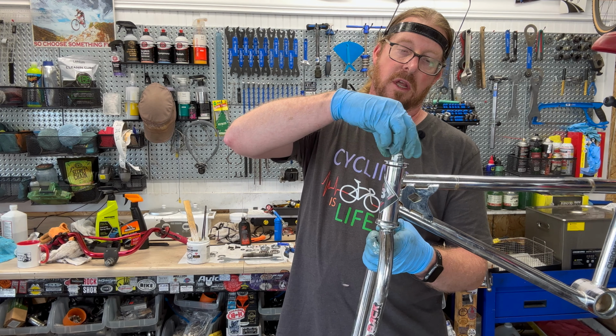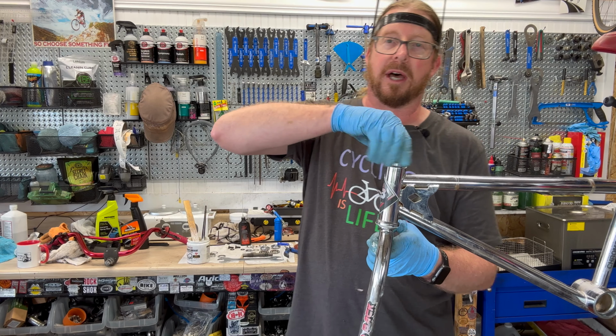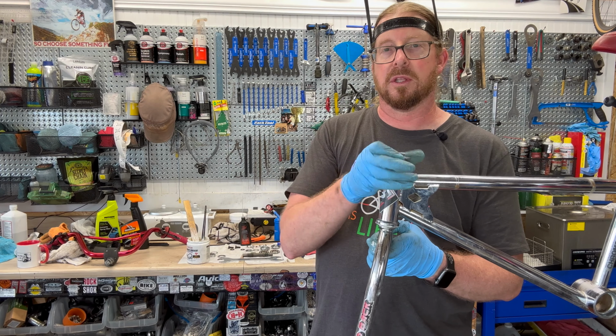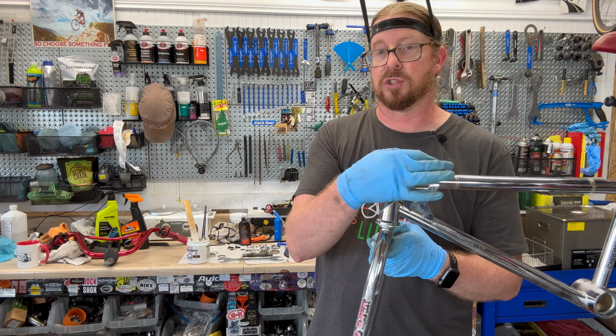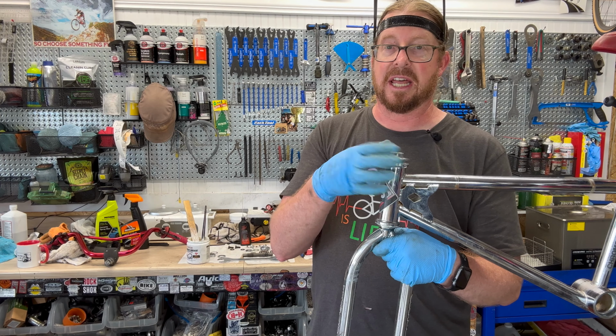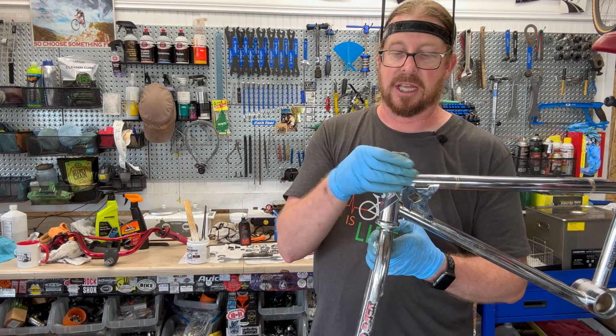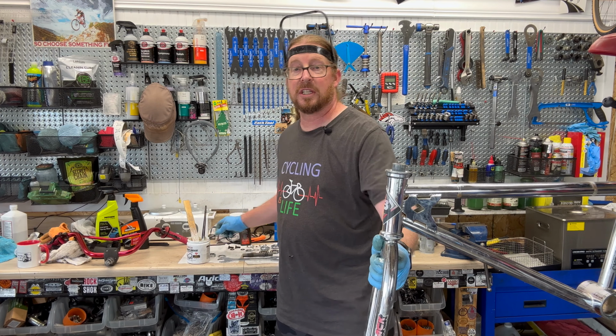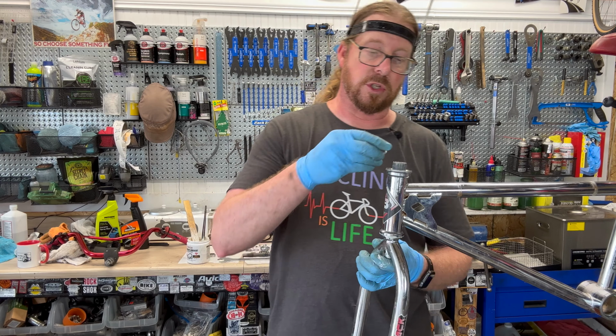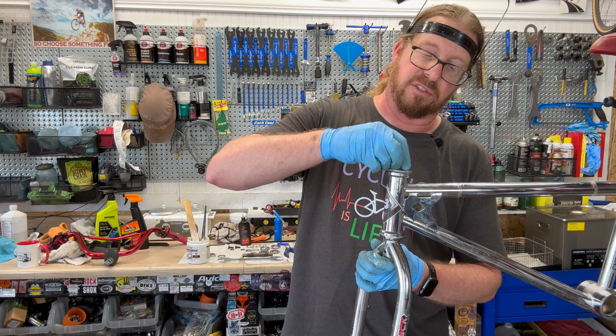And there's that one little section where it got burred by probably the spacer, that keyed spacer. That keyed spacer can wedge up against those threads, and through that slot on the back side there, could booger them up. And we'll see. I think it was a little bit higher. So just a little, not cranked down tight, just back it off a little bit so it's smooth. We're not adjusting. We're going to be adjusting this when the wheels are back on and when it's all reassembled. That's when you can actually feel a knock.